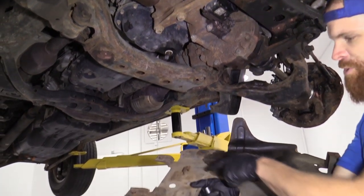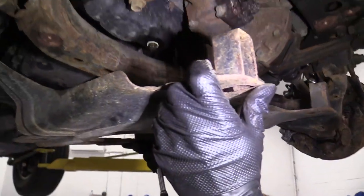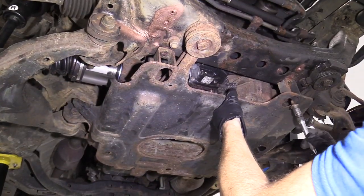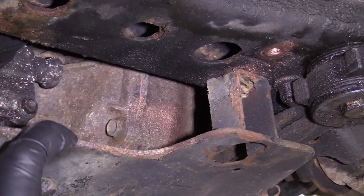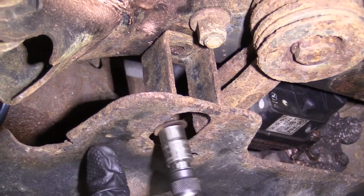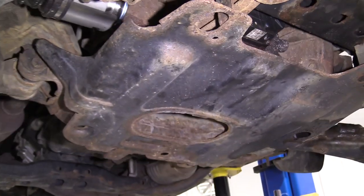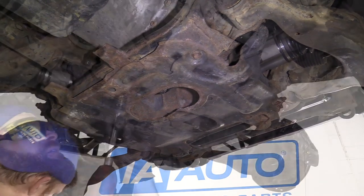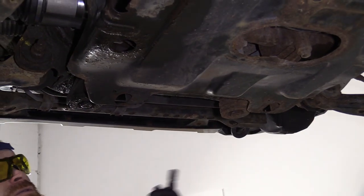It's time to put up our shield. I just wanted to show you — you've got your little hook right here, and that hook is going to go inside this hole. I have a couple of bolts in my hand, my 12 millimeter socket and an extension. The hooks hold up the rear of the plate, which gives extra help holding up the skid plate. Get those started, then get a couple in the back. We've got them all started — go ahead and tighten them up with the 12 millimeter.